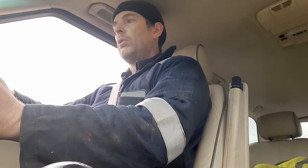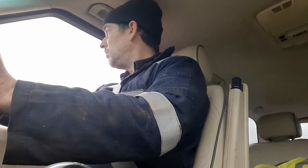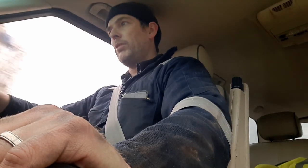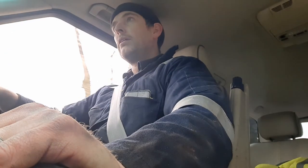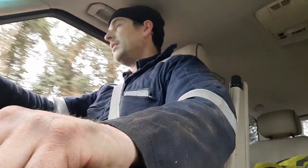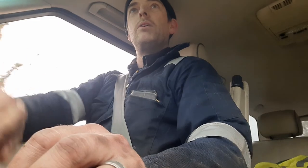So, I think it just changed gear there and I wouldn't have known if it wasn't for the revs falling. She's laboring badly, but no power. I need to pull over. I think I know what's happened. Oh, and I just knocked her into neutral. I don't have the warning on the dash anymore about the low pressure fuel sensor, so I think I just plugged it back in accidentally. So I've got no power whatsoever. Just gonna pull over. Pull that out.